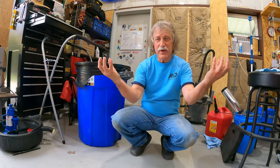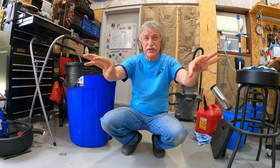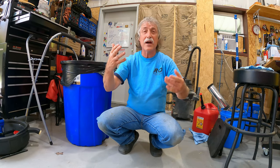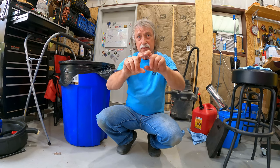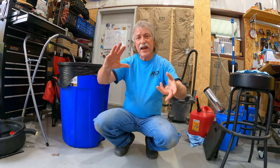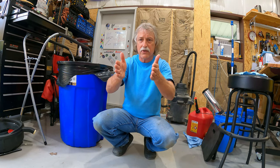With these jacks, the pucks are going to be closer in, so that's also why they're positioned where they are. For the C8, it's a much more rigid car the way it's built, so you're not going to have that weird flexing like you might on some of the prior generations of Corvettes — that's not something to be overly concerned with. Just make sure the jacks are as perfectly parallel as you can possibly get them and squared off as well.